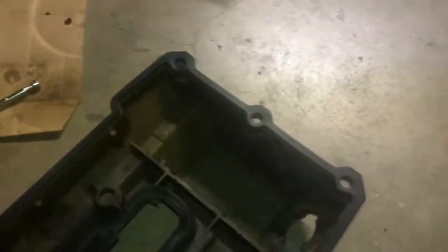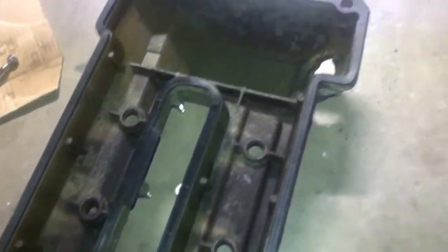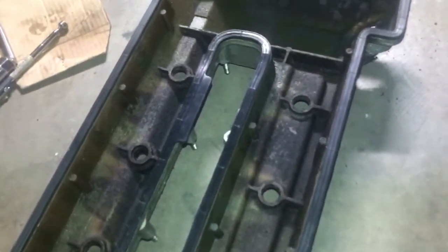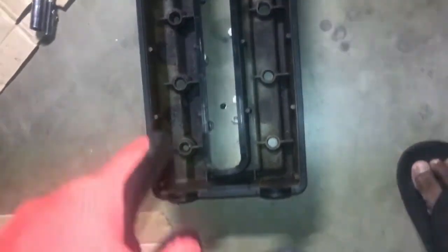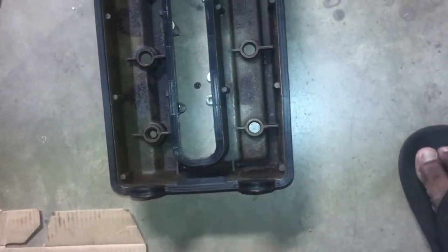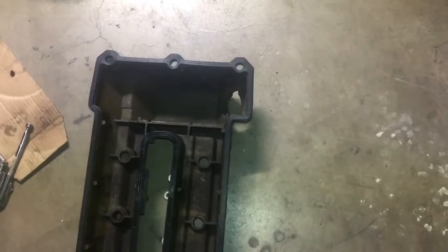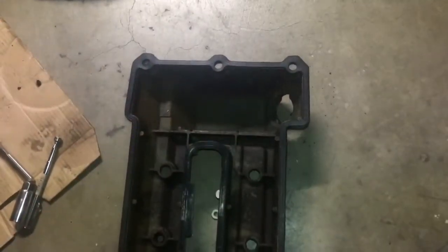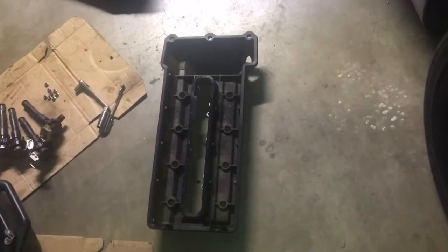When you're going to put your gaskets in on the passenger side, this is how they should look. I added this part of the video after I pretty much finished the job — I figured I might as well show you how these gaskets should look. On the passenger and driver's side, if you're looking at the front of the car, you should literally have a groove on the inside left, the two buttresses at the back, and everything else should line up exactly as designed. As you can see, this is the passenger side because it has the oil fill location right there. Take your time doing the install, and if you get any hang-ups don't hesitate to stop and rewatch.